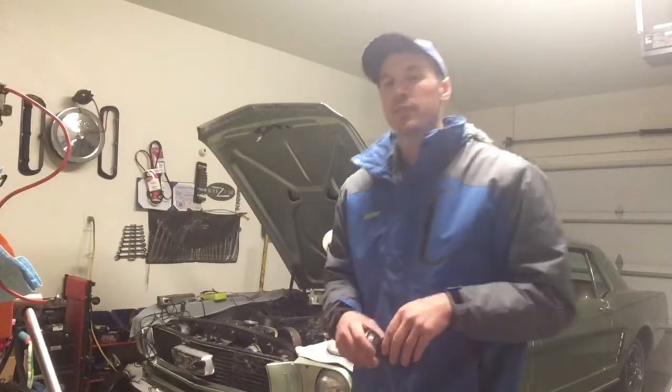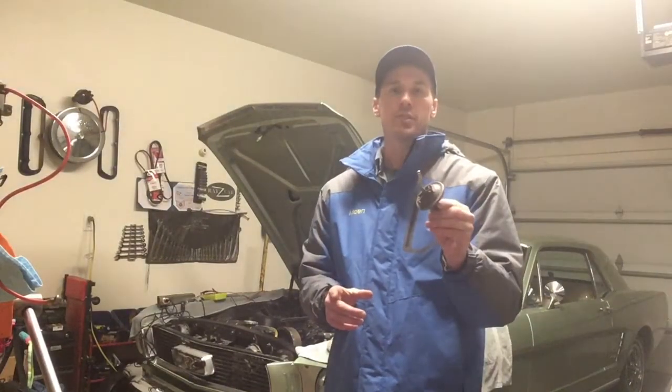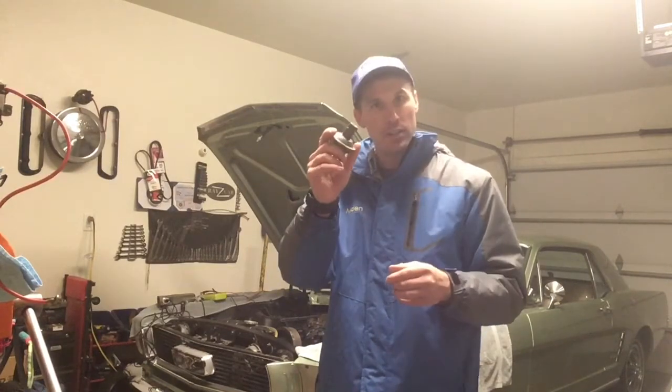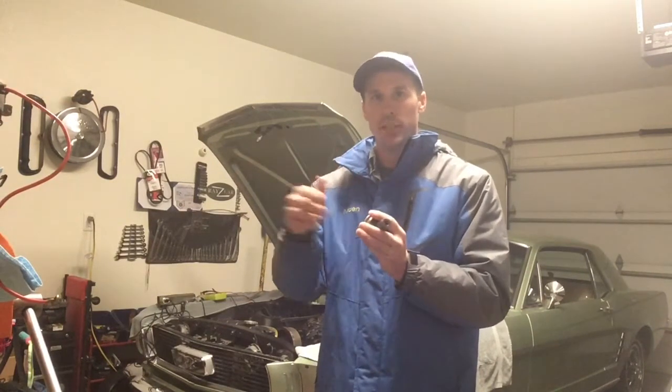And then after that, I noticed, and that was also after readjusting the timing. Six degrees of initial is what the Haynes manual calls for, but I realized that the vacuum advance doesn't work anymore, and I'll show you that debacle now.